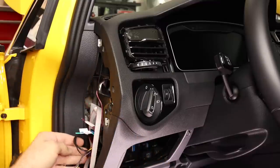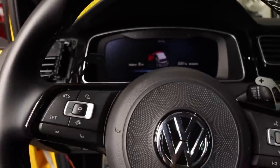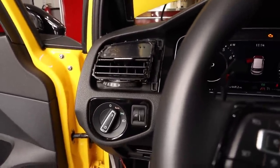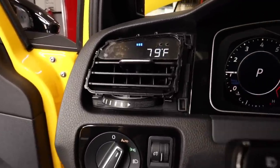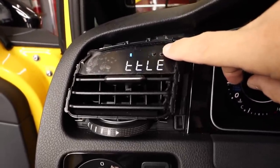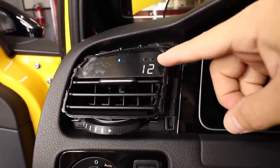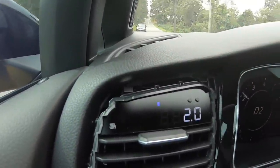We don't need to worry about our analog or dimmer yet — we just want to make sure it works. Let's see if our gauge comes on. We got our gauge plugged in, so let's go ahead and turn the ignition on. You're actually going to need to start the car in order for the gauge to work properly, so make sure you're in a well-ventilated area. There we go — she works! Let's just page through a couple of these menus. All this is doing is pulling signal out of the ECM, so whatever the ECM sees is what we're seeing here. Before we install everything back together, let's take it on a drive and see what we get.